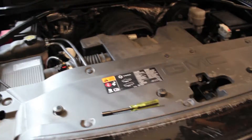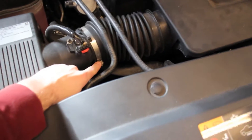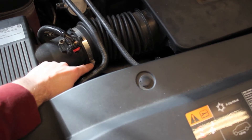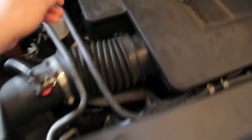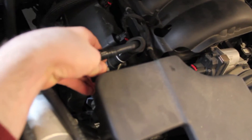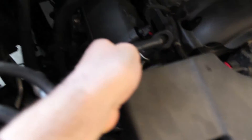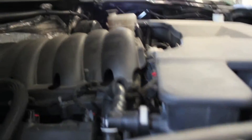I'm going to go ahead and take off the air intake tube. To get the clamps off, it's a 5/16ths socket bit — it's just a screw type clamp, so you just loosen that with a screwdriver-type with a 5/16ths inch bit on it. There are also these two vents that go to the top of the valve covers. You squeeze in the gray part — it's hard to do with one hand but I'll try to get an angle where you can see.